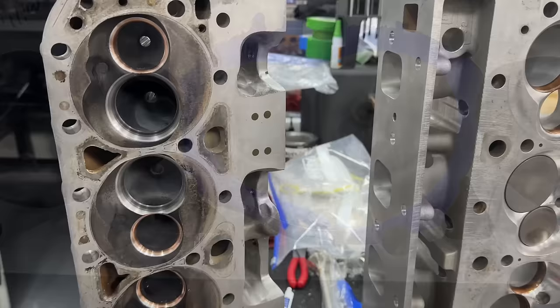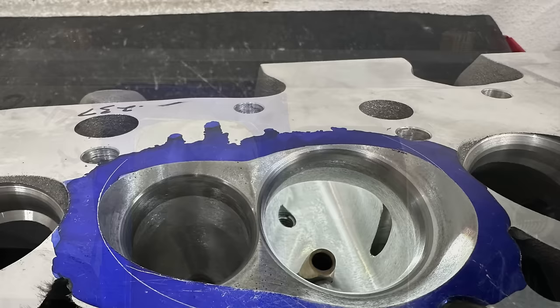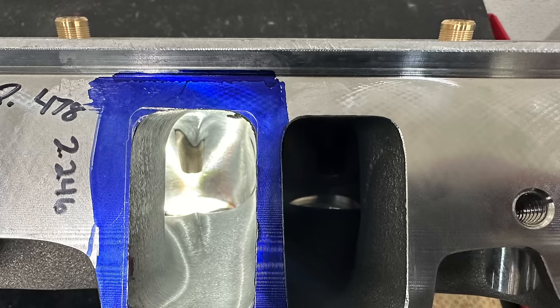I just finished this project. Now, this is a head that I sent off to get digitized to be CNC ported. If you haven't watched my channel, I've already sent off one, actually two versions, to get CNC ported. This is another one. This one is a Dragon Slayer. It won't require a shaft rocker, but obviously you can run one on it. But it has a 2.73 cross-sectional area with just using stud mounts. The thing flows like 337, but it flows almost 270 at four.